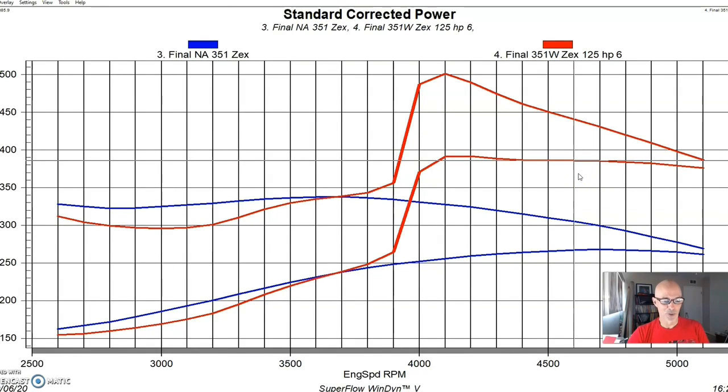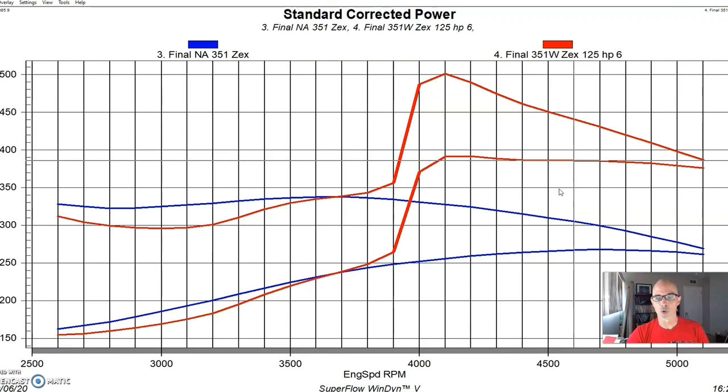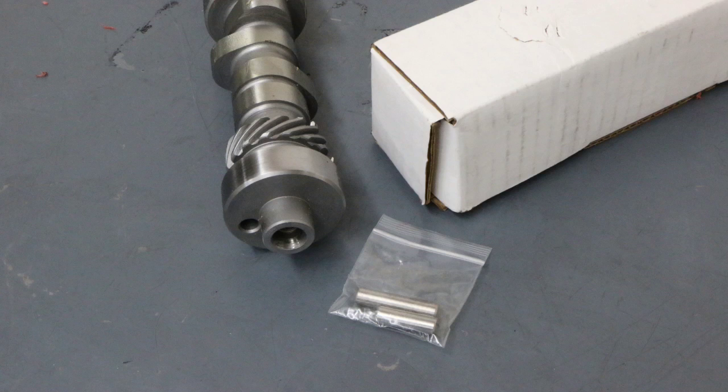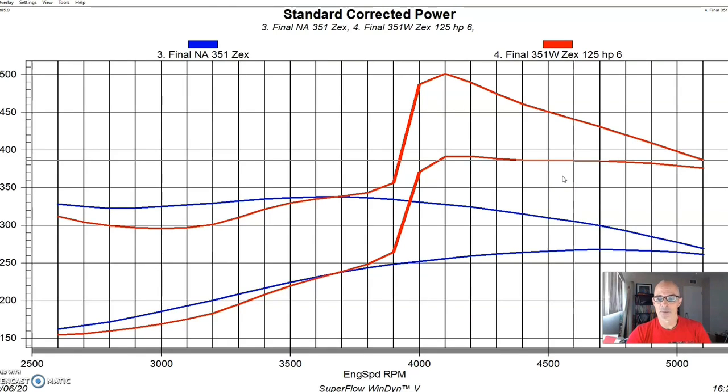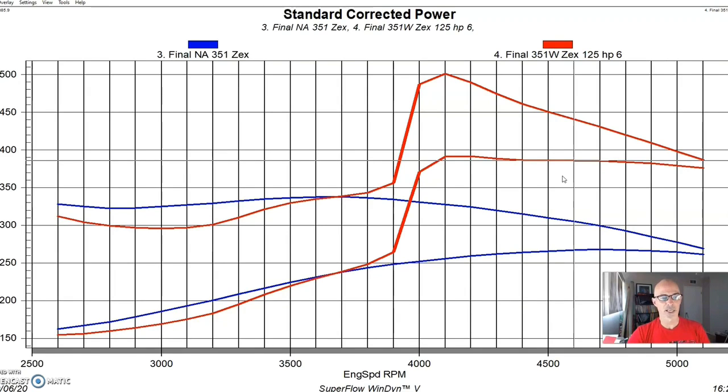Without having to spend money on a camshaft or cylinder heads, you can get there quickly. But what I would suggest if you're going to do this: if you get a 351 and buy a complete motor or even a long block, take the E7TE heads off and find a set of GT40 or GT40P heads from an Explorer. Combine those heads with your 351 - now you have a GT40-headed 351 that will make even more power. Then add nitrous. The ideal situation would be to put at least upgraded valve springs on those GT40 heads, a mild flat-tappet cam, a cheap intake manifold, and a nitrous setup. I'd think you'd be up another 60-70 horsepower at least.